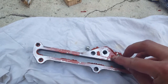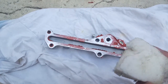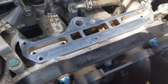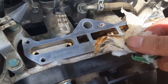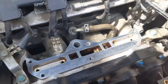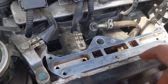So what I'm going to do — I actually cleaned the other part of the gasket with a melamine sponge. Now this stuff disintegrates, so what I did was I plugged up all the holes in my EGR pathway with cloth, and then basically just use the melamine sponge with a little bit of brake cleaner and it actually gets really clean without having to use sandpaper or anything.